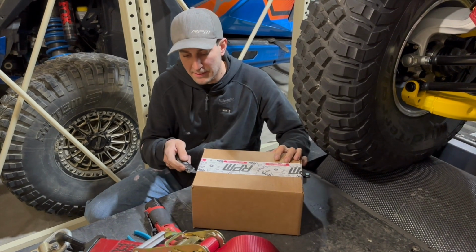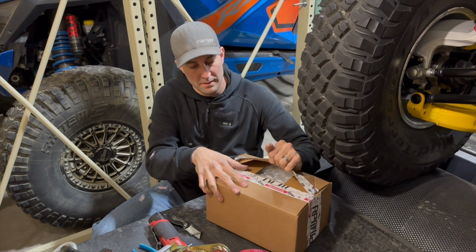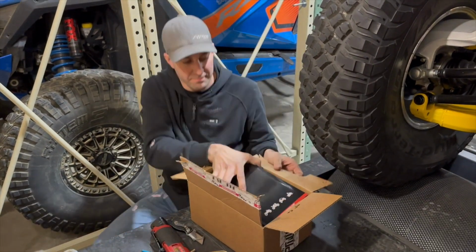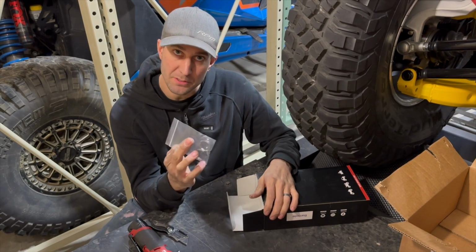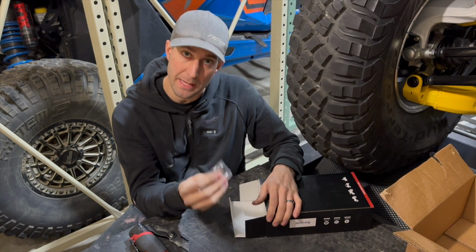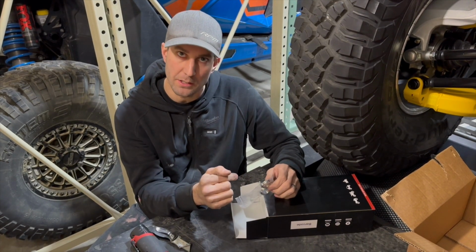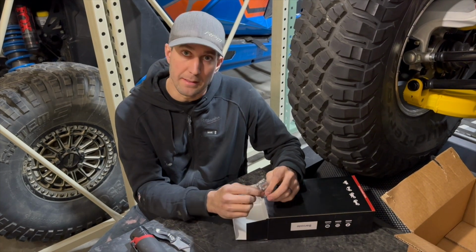This is how you're going to receive it. All right, guys, you've got 2 ear clamps. One is larger than the other. The smaller one is for your OEM intake tube. If you're running a RPM intake tube, that's the larger one. This will clamp the billet plug into your intake port. Once you start running a Catch Can, you'll no longer need that intake port, so we include the billet plug. That's what these are for.